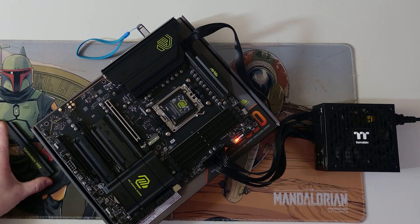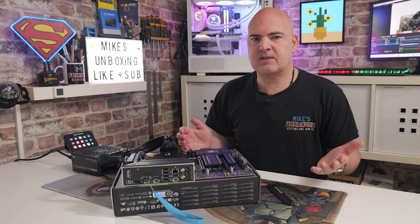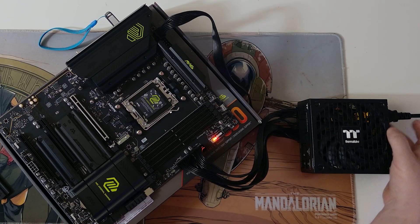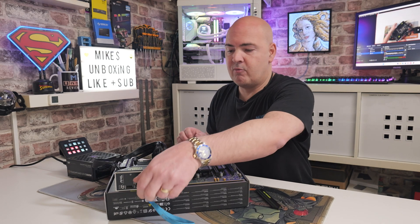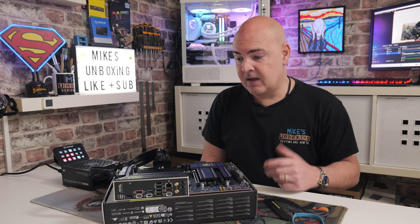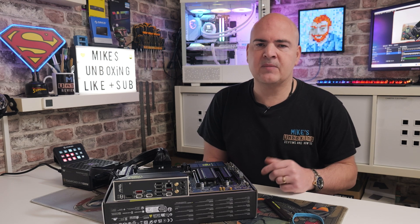The power supply has clicked off and back on again, and the LED has now extinguished. I've removed the M.2 shield so you can see the LED more clearly. The system has effectively rebooted and we still have the CPU and DRAM LEDs on — that's completely expected because there's no CPU or RAM installed, so the motherboard doesn't know what to do. That's pretty much it. Turn off the power supply, remove your USB stick, and remove the connections. If it's built into a system already, go ahead and repopulate your RAM, graphics card, M.2 drives, etc. This should update your BIOS to the latest version.